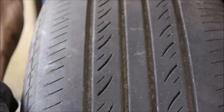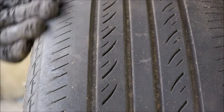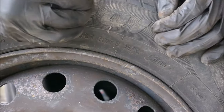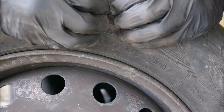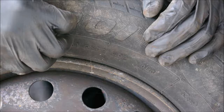Unless of course the side of the tyre is showing cords or metal. Be careful when you do check your tyres, just in case there is some metal showing. You could also have damage on the sidewall where a chunk of rubber is missing and showing the cords or sidewall inside that cut. That also would be a failure and be pretty dangerous.